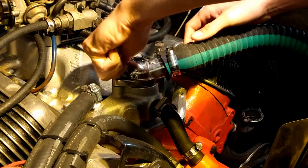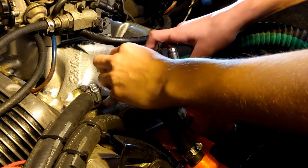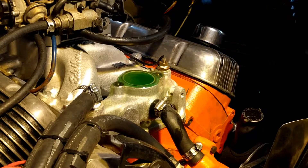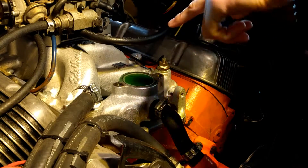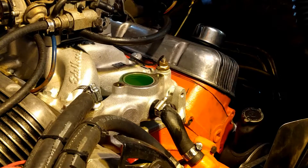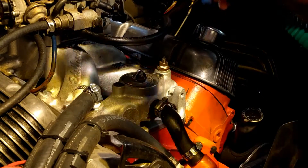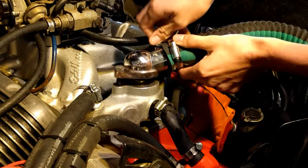Alright, so there we go. We got both of these out and now we're going to take this off right here — and water is probably going to come out. It actually got inside the intake manifold down in here in the air gap, so I'll be cleaning that up in a second. But anyway, we take our thermostat right here and we stick this part down in the engine just like that. It's that easy, and then you go back over here — this is a 160 thermostat — go back in here and tighten these bolts up.